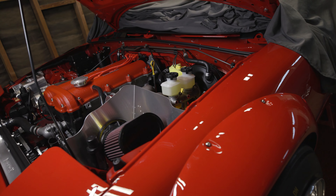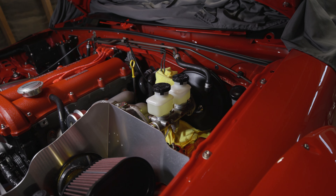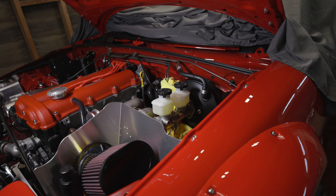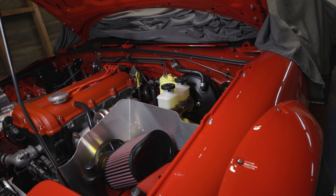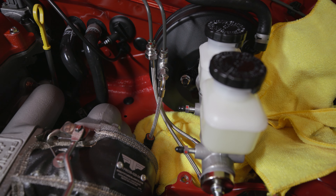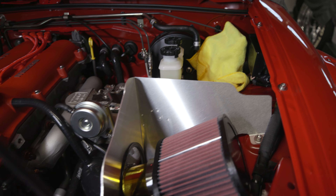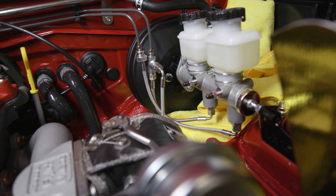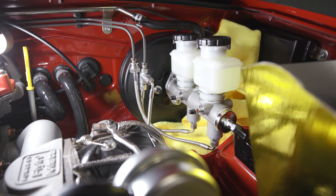Today I'm gonna be redoing my brake lines. Something happened yesterday when I was warming up the car and stepping on the brakes — one of the o-rings for the fittings I'm using popped off. In December I got this new fitting and new hose assembly. You can see the flex lines but they gave me the wrong size. The fitting taper — the inverted taper — is actually 37 degrees, which is your typical JIC AN, and the one on the car is a 45. So some of them worked and some didn't, and it actually pressed out the o-ring.